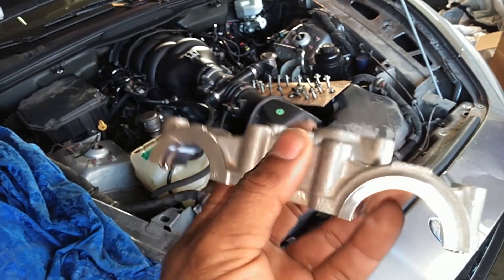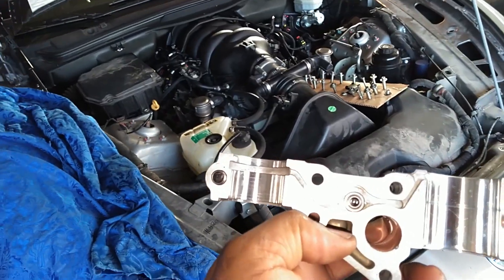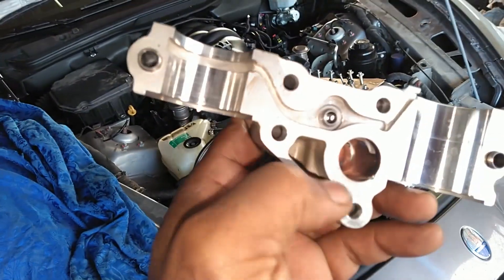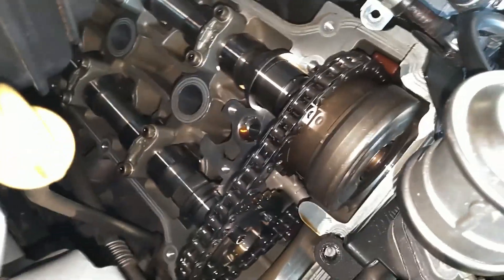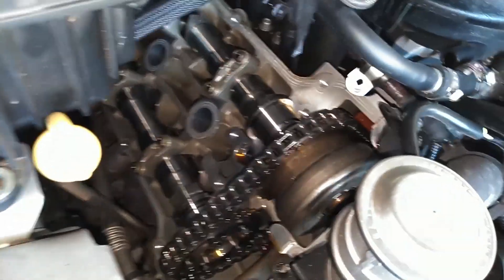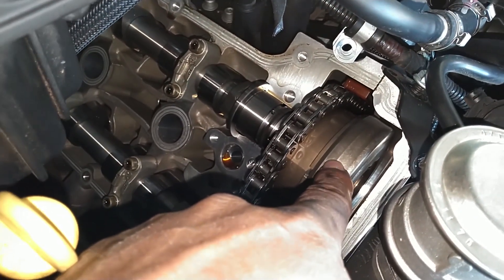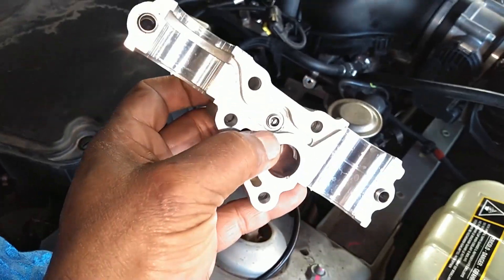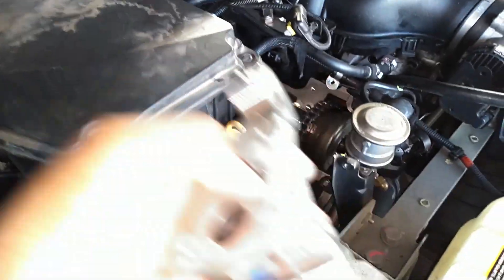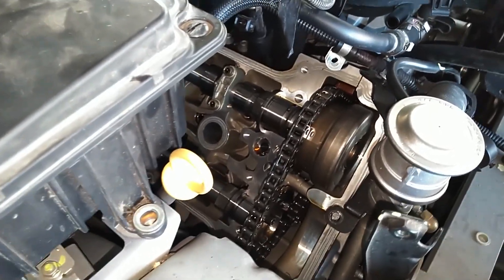In the event that doing this is going to save the variators, we won't have any noise at startup. Down here we have, of course, the dual cams. This is the variator here. When these variators wear, they make noise. This valve is supposed to help keep oil up there so that those variators don't have somewhat dry starts.